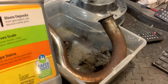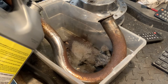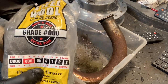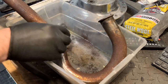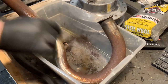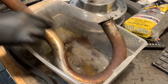So the first 30 seconds was pretty darn amazing, I'm not going to lie. All I did was just drop a little bit of CLR on top of it — just pour just a little bit. Got a little bin here so I can kind of dab my steel wool. I'm using some triple-O grade steel wool. Some people will be like, too coarse — you should be using 4-O or bronze wool. But I'm not too worried about scratching because this pipe is going to get wrapped in black exhaust wrap. But before I wrap it, I want to make sure that it's nice and clean.